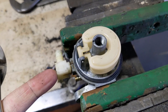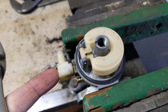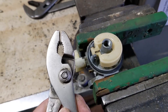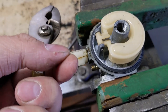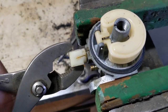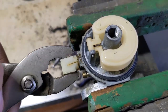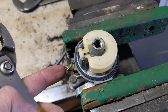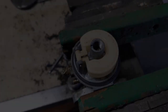Now that we've established that the plastic 90-degree fuel inlet leaks, how do we go about removing this so that we can install the new one? To do that, you can use a pair of pliers. Because the plastic fuel inlet is cracked, it has opened itself up, which makes it easy to turn. Basically, because it's already broken, we're just going to pull that right off, and it will expose the brass insert that fits snugly into the carburetor.